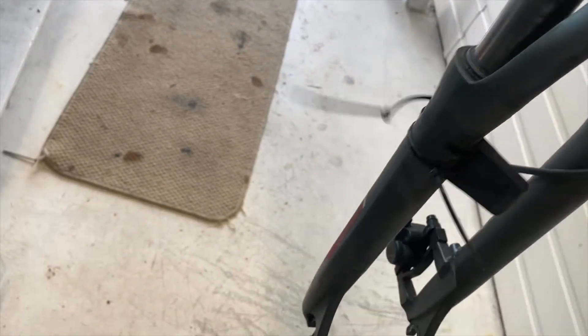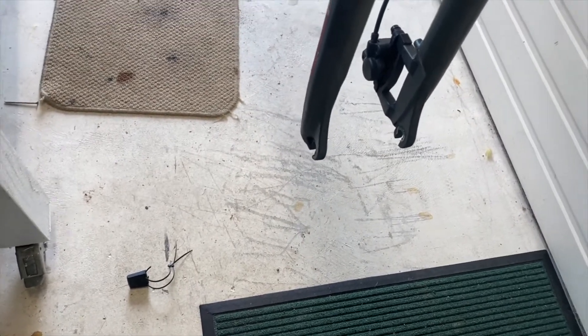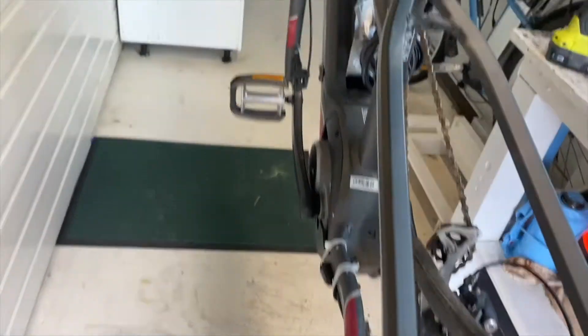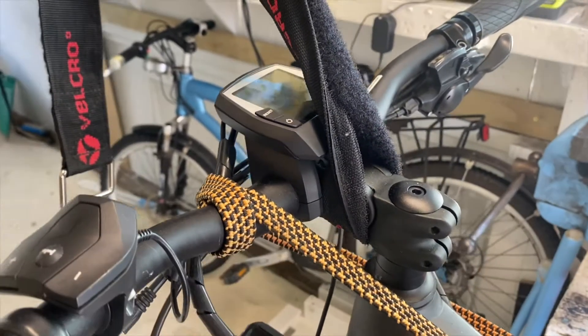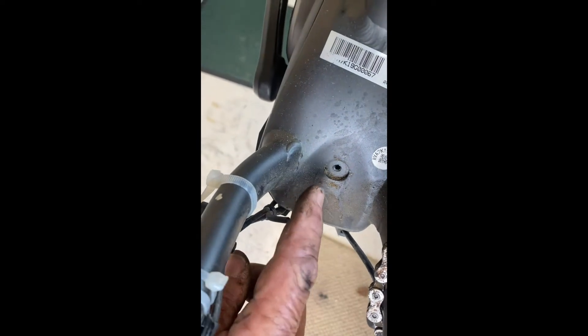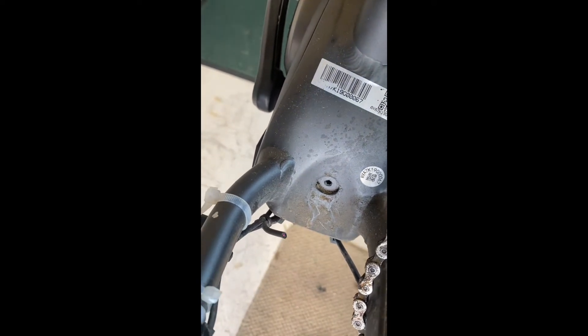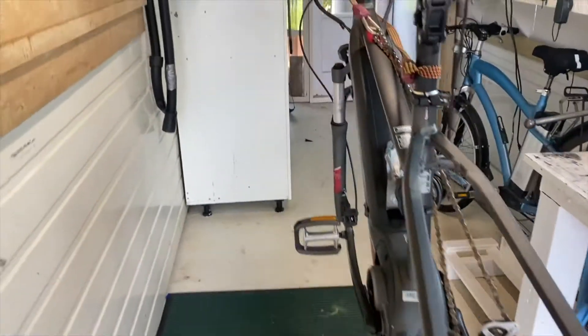When I de-restricted the bike I couldn't tell the correct speed anymore. So I bought a new unit from China — that's the receiver unit there, and you put a new sender unit on the wheel. That tells you the actual speed, because now my gauge on top only reads 15 kilometres an hour when in actual fact I'm doing 50. I also need to make sure that hole into the engine housing is closed — there's a rubber washer sealing it up. Good, that's sealed.